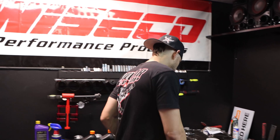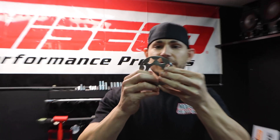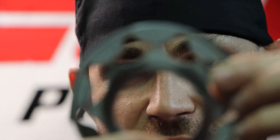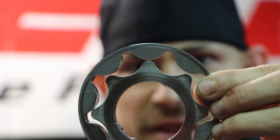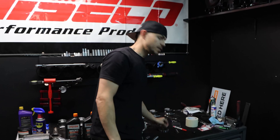Patrick's engine came to us with piston ring issues — it was just burning oil and stuff like that. But the other problem we found is when we pulled the oil pan, there was just a ton of metallic sludge under there. That was due to an oil pump gear that had incorrect tip clearance. We shot it with a 0.025" feeler gauge — it had 28 thousandths of tip clearance when I pulled it out of his engine. Went right in the trash.